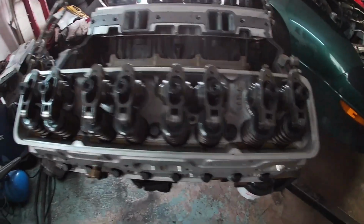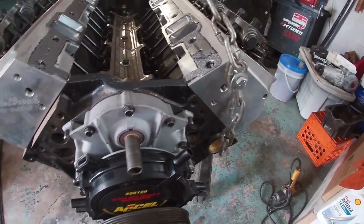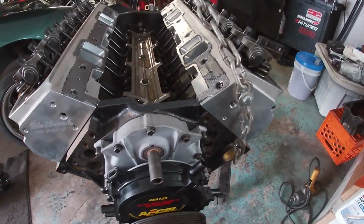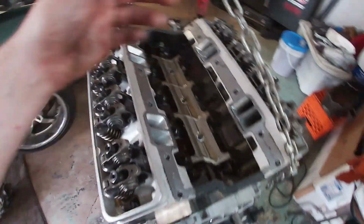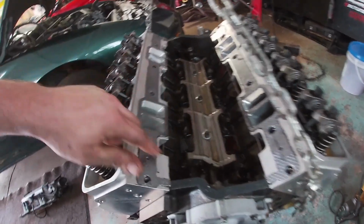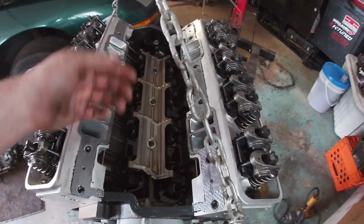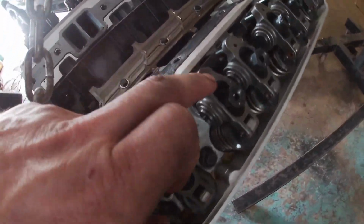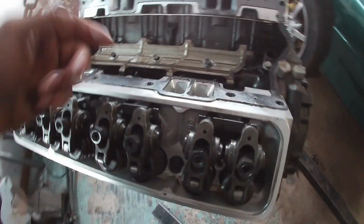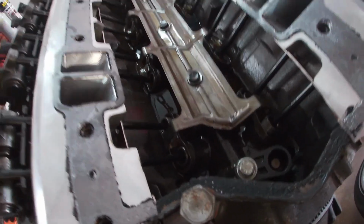All right, guys. So, I just did two full revolutions, so 8 90s, to make two 360s, which is two turns. And everything is good to go now. I adjusted everything that I needed to do. We got the lifters primed, the oil pump primed. All the oil is coming out of here, you guys seen. So that's how you know that basically everything's full of oil. So happy with that now.